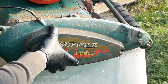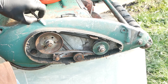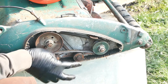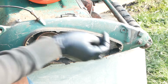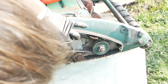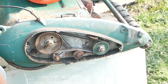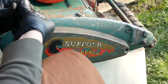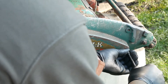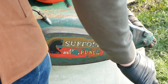Looking at the clutch side — that's a nasty old belt. So this is my clutch adjustment: when I pull the lever, it raises a tensioner, tightening up the belt enough to make the back pulley spin. But why does it sometimes launch forward on its own? It's clearly engaging when it shouldn't. Reading the manual, a new belt is definitely needed. I've loosened it off a bit more, though I don't think that'll make much difference — we're just going to start it on the ground where it won't run off so easily.